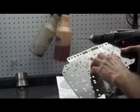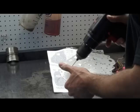All these hole sizes are in the instructions. You can kind of mark the plate like this to show you what holes to drill. I usually start with the small ones. I've drilled this hole to 55 thousandths as per the instructions. The rest of them are different sizes, but I do all the same sizes at once.